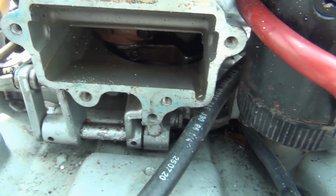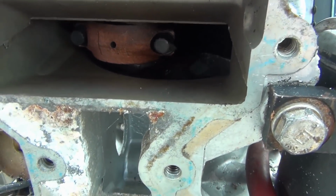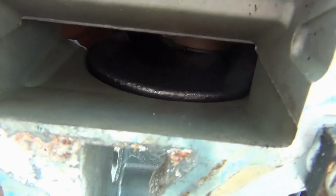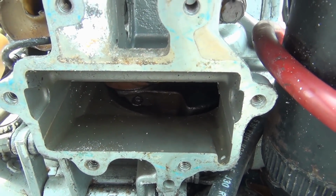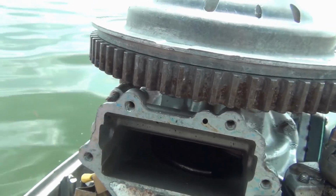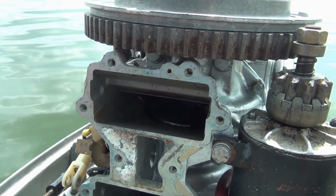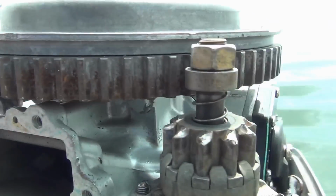Top is in. Yeah, top's coming back out. And man, this thing's hard to turn by hand. Crankshaft seal, top, bottom. There's no evidence of anything leaking on the top. Now, if it's so slight at idle, it's got to be more at high speeds, and you should see some kind of oily something up here somewhere. You can rub your fingers all over this thing. It is clean.